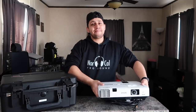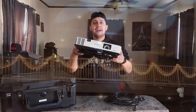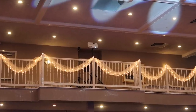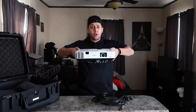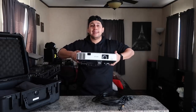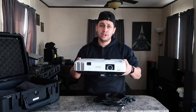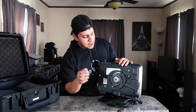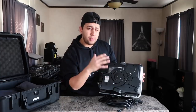The real science behind it is the mount. You need a mount that's going to let you maneuver the projector all around. When you're doing monogram projections you could be shooting up, shooting straight forward — which is the ideal situation — but oftentimes you're not going to have that luxury. You're really at the mercy of the venue. The mount you use for your projector is going to make or break whether or not you can use a projector. Here I'm using a mount from Colorado Sound and Light, and it's designed to fit multiple different projectors.